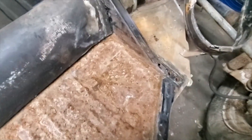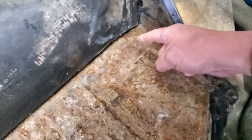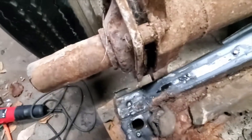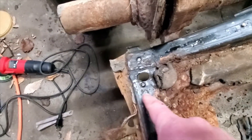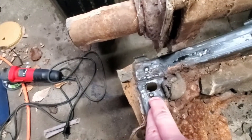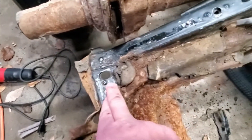I'm going to get out my four and a half inch angle grinder and cut just to the inside of all these flanges that the pan is welded to. I'll use the cutting wheel and cut all this metal away all the way down and around, cutting it off right about here where that flange goes out, and cut all that stuff out of there so the pan drops away and is out of the way.